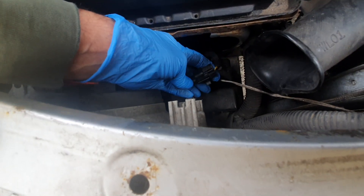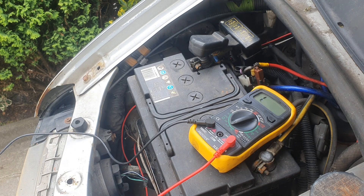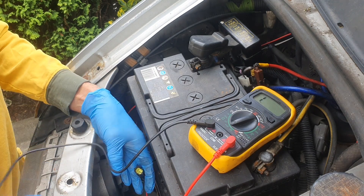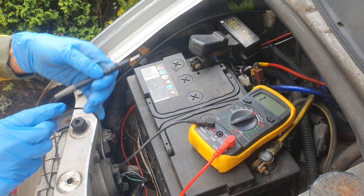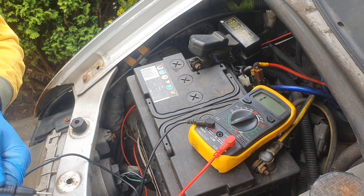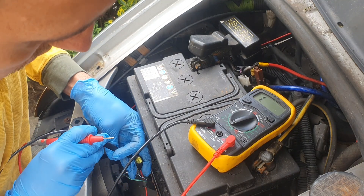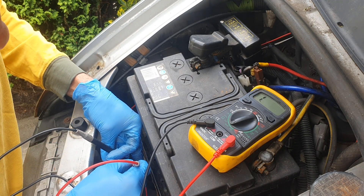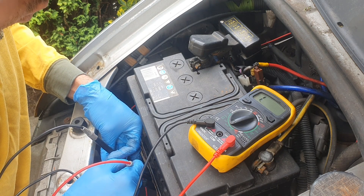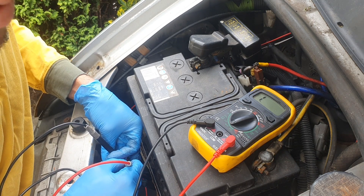So there's our connection, we're going to check that now with the meter. We've got it set to 2,000 ohms to check resistance - this should read about 1,600 to 1,800 ohms. But all I'm doing is putting it on the pins and we've got a total open circuit, so there's a wire broke somewhere. We'll just strip it out.